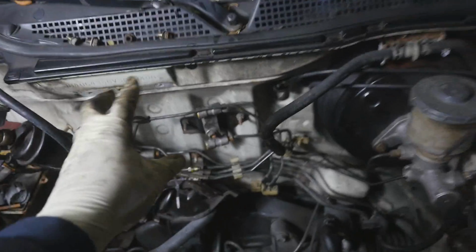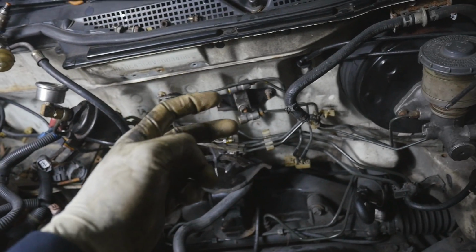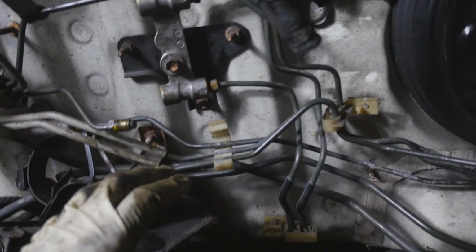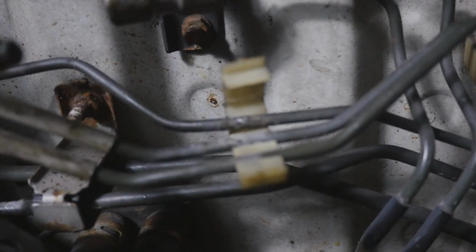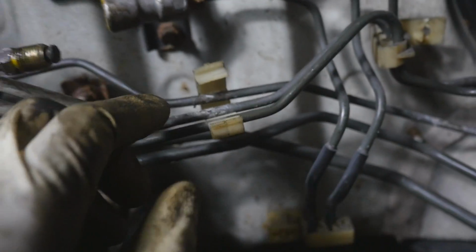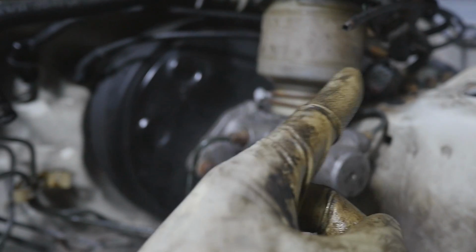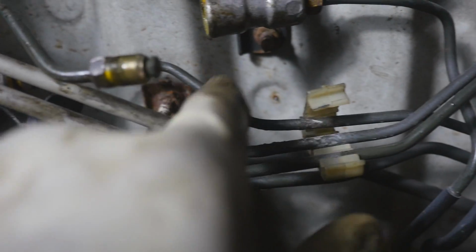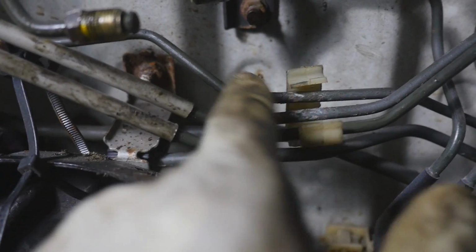All right, so you took off the bracket for the fuel filter, or the fuel line, and you took off these 2 for the whatever kind of prop valve this is. Now, you want to be careful, because I noticed something when doing it, getting ahead of myself instead of telling you guys in the first place. So this line, this bracket, you have to break off. You have to get the vice grips or a wrench or whatever, and break this one off. Reason for that is because this back line routes all the way to your clutch master cylinder. So if you rip all these lines out, you're gonna rip that one along with it. So be careful with this one. All of these ones right here you can rip out, but this one back here, nada, can't rip it out. So I just disconnected that, broke it free. That way I won't make a mistake and rip that one out by accident.